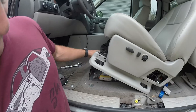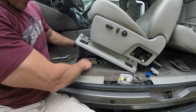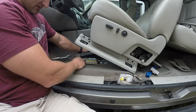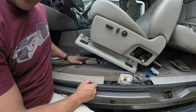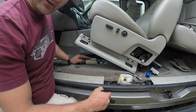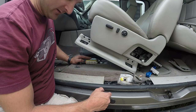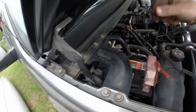You can kind of see down here — right up under there. Right there — these yellow plugs. That is to do with the airbags. These are 10-millimeter nuts, there's three of them. You could almost have done this with the seat in, but it's a lot easier this way. Before messing with any airbag components — technically anything with a yellow tag — you need to remove the ground off the battery so that it doesn't trigger anything when you're removing this, because it can. And if you have airbags that haven't deployed yet, they could deploy, and then it's more costly because now you've got to get more airbags. So I'm going to undo the battery and take this out.